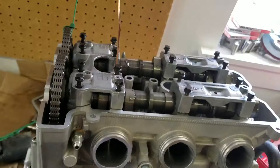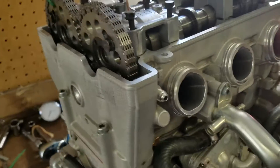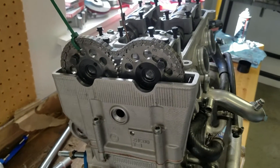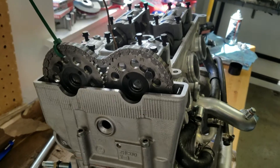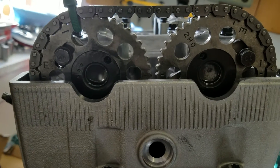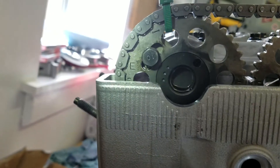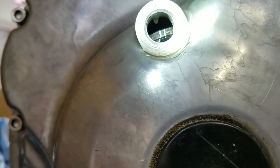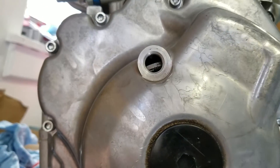So I'm going to do that and get the valve cover on. I'm actually going to check the valve lash, and if I'm out of spec, I'm going to have to order shims. Here we are with the cam alignment — you can see marks there, marks there, marks there. Cylinder three is at top dead center as per the manual. This is the eye mark, so the mark right in front of the eye, the elongated eye.